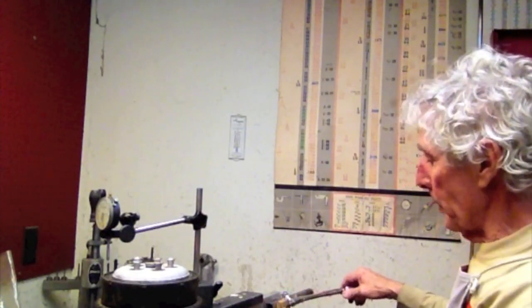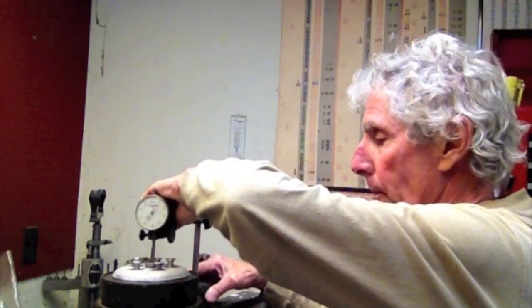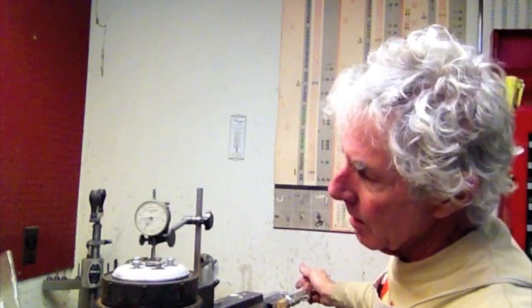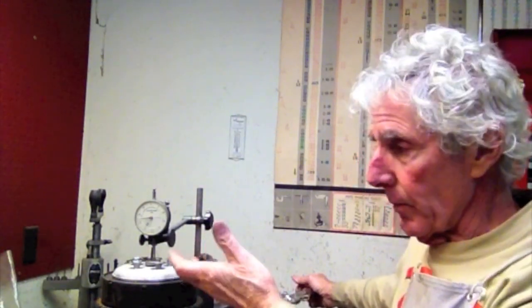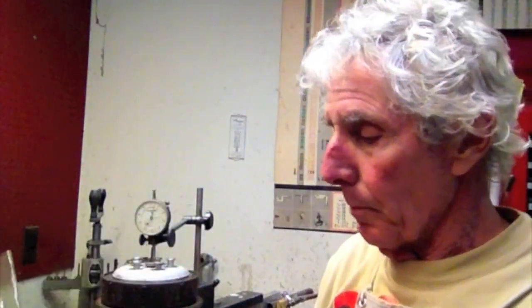You might want to have, in the imperial system, an eighth of an inch — two to three millimeters metric is adequate. When you go to operate this clutch, you're looking for maximum lift. By setting it at a quarter turn instead of half a turn of slack, and taking out the slack elsewhere, we've now increased our lift by 50%: it was 50 thousandths, it's now 75 thousandths, and you can see a lot more daylight in this clutch. I think that'll solve 99% of the problems you're having. The remaining issue is inherent in the fact that the clutch baskets have a little wobble and the plates are not perfectly flat — it's inherent in the design. I think you'll see a big improvement. Good luck.